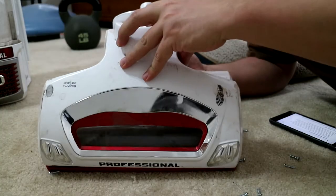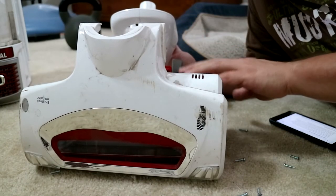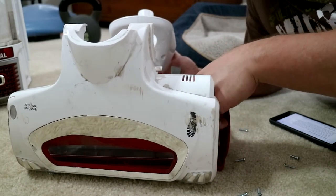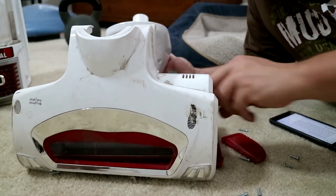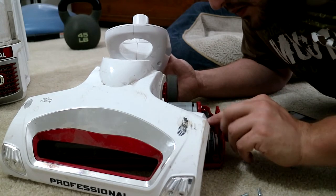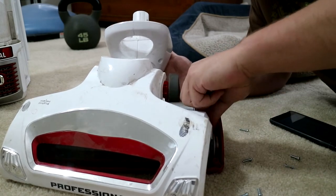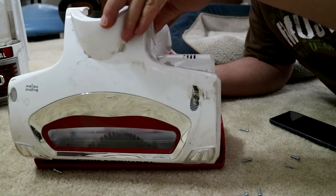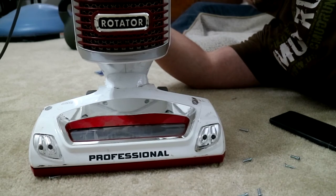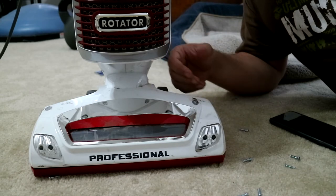Let's try something real quick. Vacuums get really dirty. As far as I can tell, there's no blockage there. The motor looks good, albeit a little dirty. I can manually manipulate the belt — you guys can't see this — but the belt is without issue rotating the roller itself. As far as I can tell, all of that is good. There's no blockage here either. I'm going to go through all the different hoses that could potentially block this up, then screw everything back in and test again.